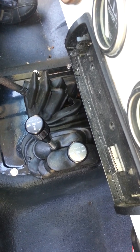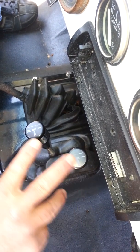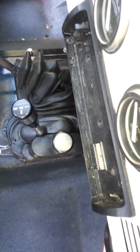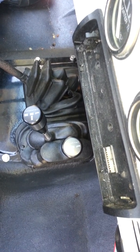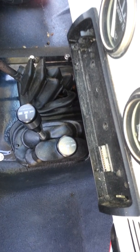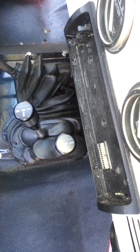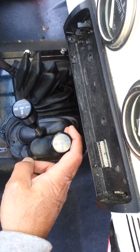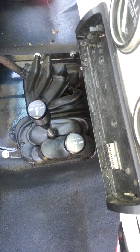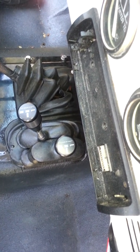I'll make some notes when I get home — maybe a little cheat sheet. I have a small decal if you want to put it up there, but the thing is it won't shift if you don't do it in the right order. Typically I'm only moving this one lever back and forth since you rarely go into low. This position is the easiest shift — short throw too. Go ahead and lock the hubs and give it a ride.